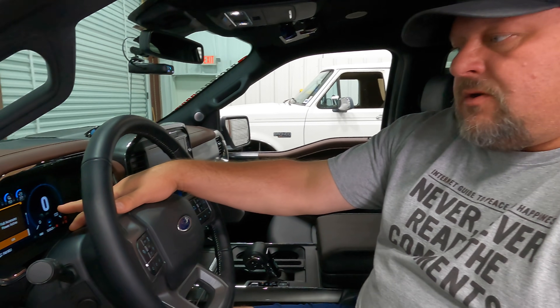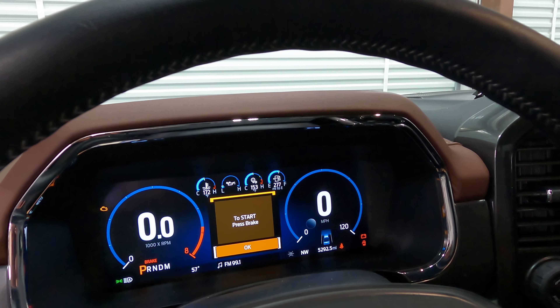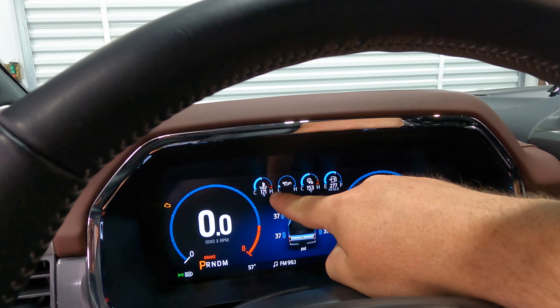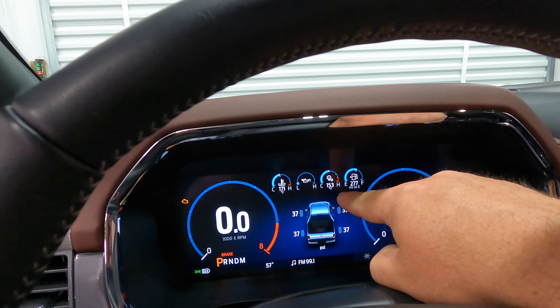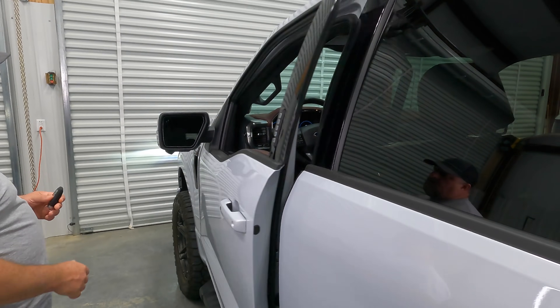Now I'm going to show you some of the features I was able to put on this truck so far. One of the things I showed you in a previous video: first thing you can do with FordScan is change your gauges to show your coolant temperature and transmission temp on your dash - so you know an actual temperature instead of an arbitrary one. Another thing you can do is get rid of that annoying double horn honk when you get out of the truck while it's running with your keys in your hand. We'll start it up - and of course it doesn't honk now because we turned that off. That's a very neat feature that is available right now.